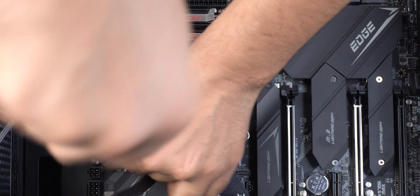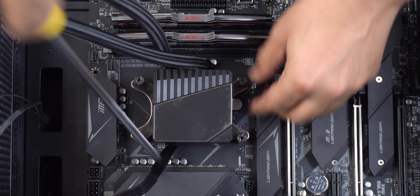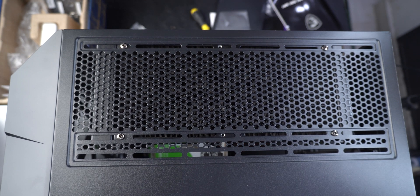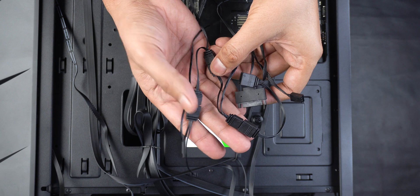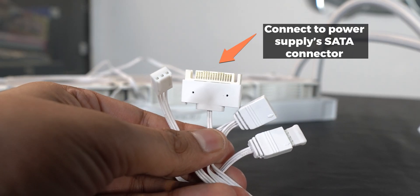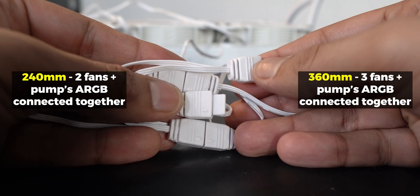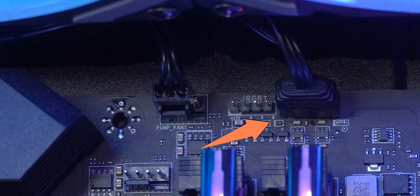You had one job. But because the pump sat pretty nicely and wasn't loose at all, that assured me the installation was done. I simply installed the radiator on the top shelf of the case, making the fans face downwards to throw hot air out from the top. The fan connectors and headers were already daisy chained in both AIOs, saving a few precious minutes. The SATA power connector powers the pump from your PSU, and the 3-pin power connector goes on the AIO pump header or CPU fan header. I also daisy chained the ARGB connector from the pump to the fans and connected it to the ARGB header on the motherboard.